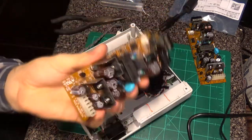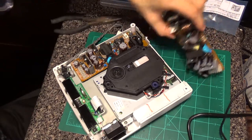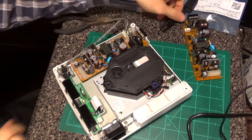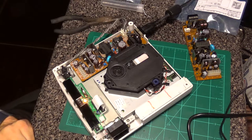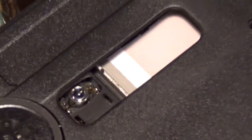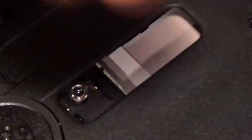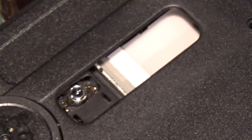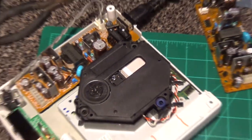Just to prove that there's an issue, I haven't changed the caps on this one yet. I'll go ahead and install it now — this is actually a different board from the one I just built. The power and the fan turn on like normal, but yeah, that laser isn't turning on. There's like no light coming off of that. So there's definitely something wrong with these power boards that causes the laser not to turn on.